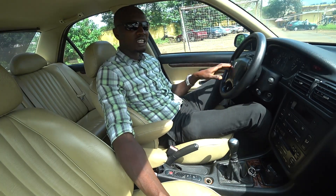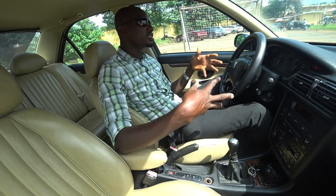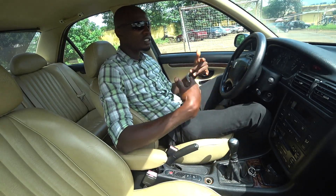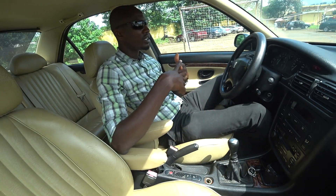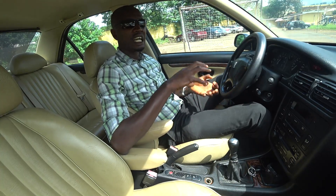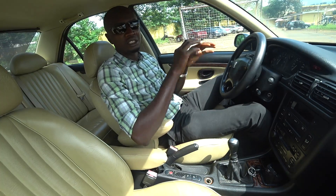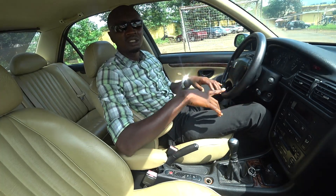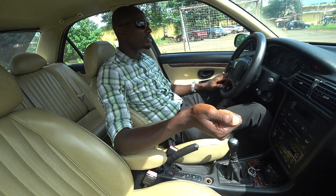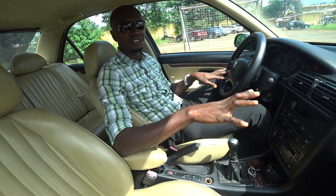So which makes sense to me - if I have a Peugeot 406 with EW12J4 engine, whether it is the one with the front reverse or not, as long as it's five-speed, I'm going to swap in a six-speed manual from a Peugeot 407 with EW12J4 engine and manual transmission. They all have six-speed manual so they are available. What you need to do is: the CV joints should be the same - I don't think you need to change your CV joints or drive shafts, they are the same length. You may need to change the bracket attached directly on the gearbox that goes up to the gearbox mount - there's a plate attached on the chassis. That may or may not be the same - I've done that conversion once. Other than that the gearbox will fit in, and you start enjoying the six-speed manual.